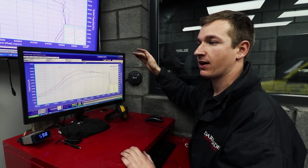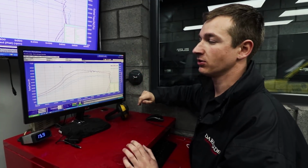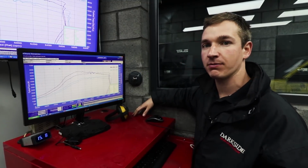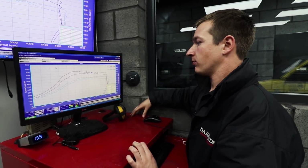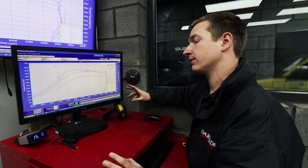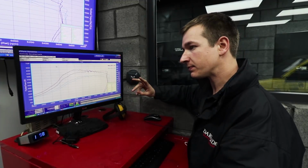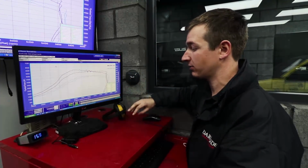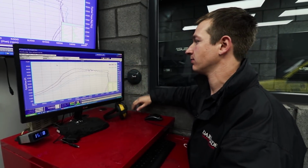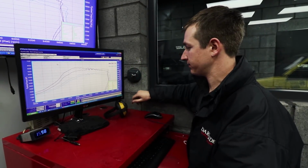If we added any more nitrous to that, all that happened was it got leaner and leaner and leaner. And we're at sort of diminishing returns. So we said, well, the only other option we've got is put some bigger injectors in. These are already massive custom injectors. They're pretty near to what the stage twos are that we're just doing some testing on now, that are going to go in the Citigo and everything as well. They've increased in size a little bit. So that's as much as you're going to get out of them anyway. We stretch them a little bit further than you want to stretch them. 500's about where the stage twos are going to be safe.